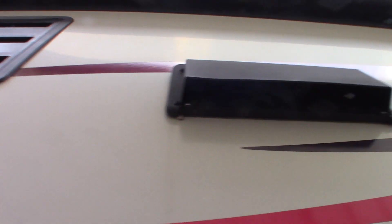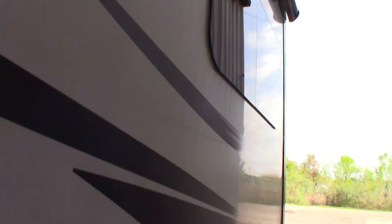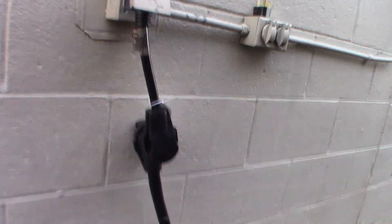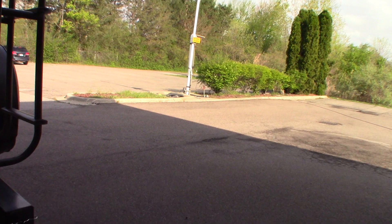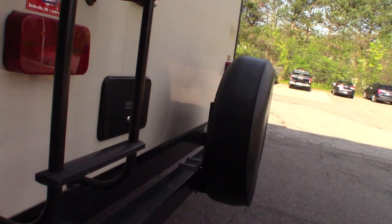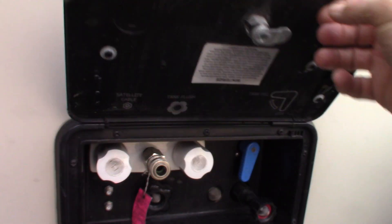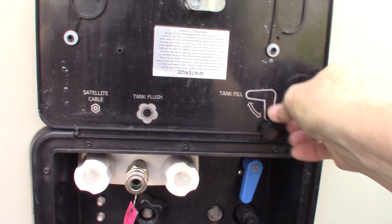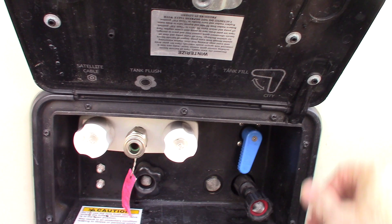This is the service panel for your refrigerator. That's a vent for your range hood — it has two little latches on it, just make sure the latches are open so that baffle can flap freely when you're venting. You have a 50-amp power cord, plus we give you a reducer to go down to 30 amp, and another one to go down to 20 amp for an emergency. On 20 amps you can really only operate your lights and basic things.